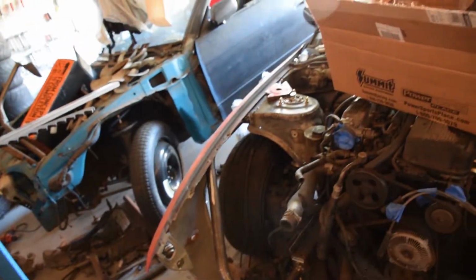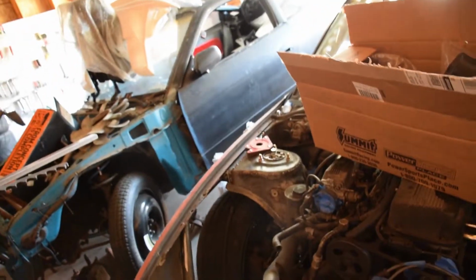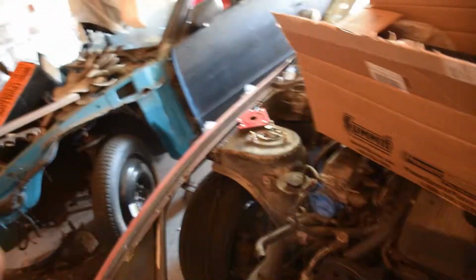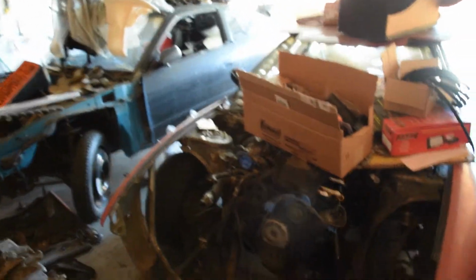Still gotta finish wrapping this car, obviously. I gotta do the radiator install, battery relocation, and finish up my tube front. I gotta mount my seat. I'm gonna make my own rails. Mount battery box, mount fire extinguisher bracket, and then weld the diff. And I think I'm ready. I do have a drift event coming up in July, so that is the goal. And hopefully we can get some good seat time in. Oh yeah, I got a kill switch from my buddy Brian, so he hooked me up with that one.